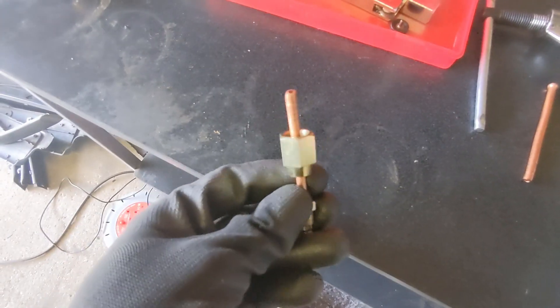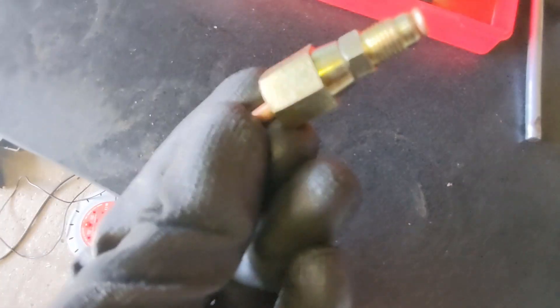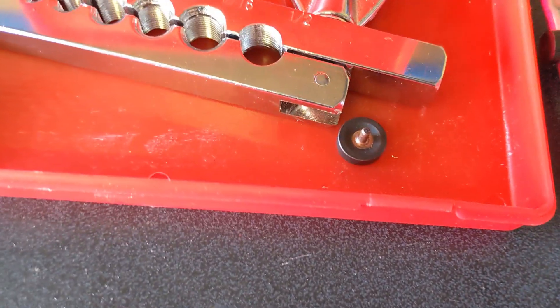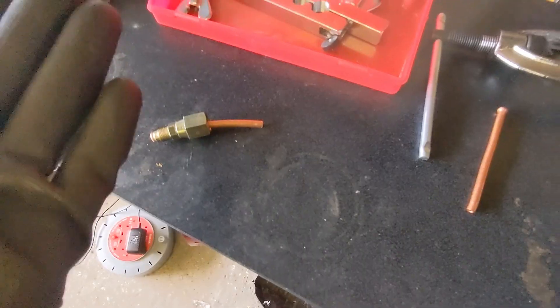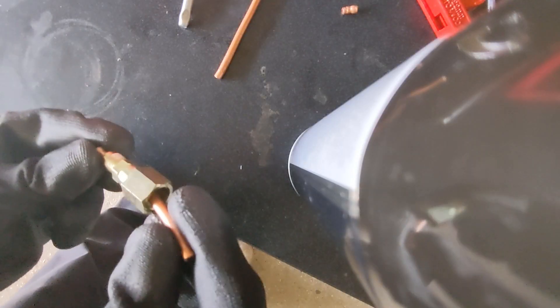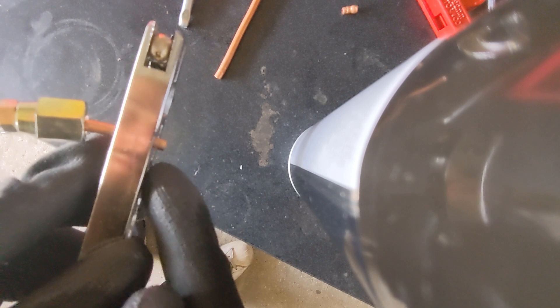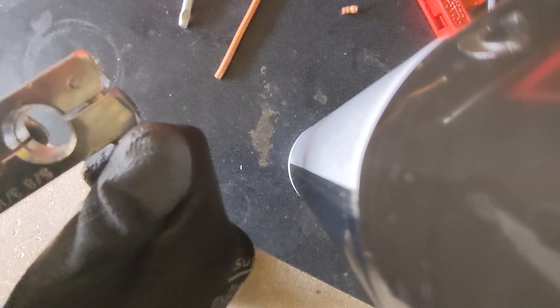For now I'm just going to add this fitting to my brake line, flare it, and complete this ABS pump delete. I've got my tiny little brake line here — one side is already flared and has the fitting. After your line is cut and you have your fittings on there, make sure they're all the right way around. Get your weird-looking crocodile mouthpiece, find the right size hole which is 3/16th, and make sure a little bit of the brake pipe is sticking out — Harry said about 3mm. Tighten the rear butterfly clip, slide the front butterfly clip over and tighten it up as well. It's really important to make sure the whole thing is extra tight so the brake line doesn't slip out.